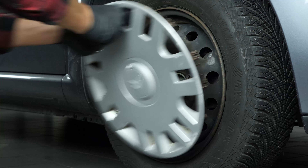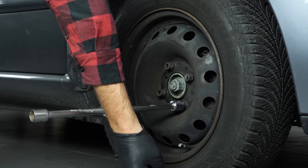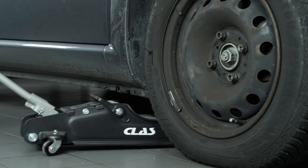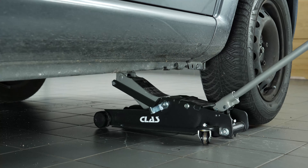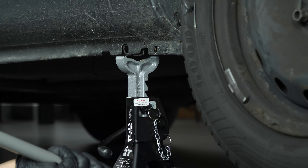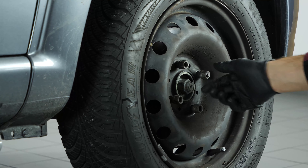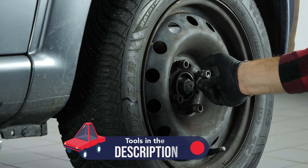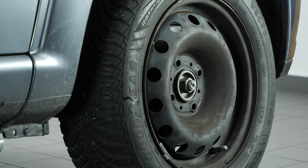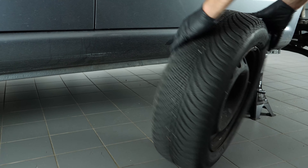In order to change the drive belt on your vehicle, you're going to have to lift the front and remove the passenger side wheel to have complete access. Unscrew the wheel nuts, lift the front of the car, and place it on the stands. We strongly suggest watching the tutorial 'raising your vehicle safely' before carrying out this step. You can then remove the wheel. Don't forget to slide it under your vehicle.